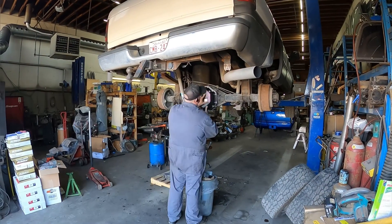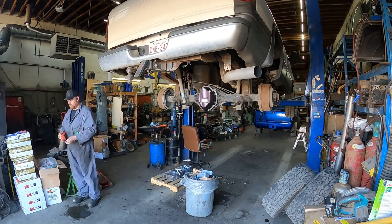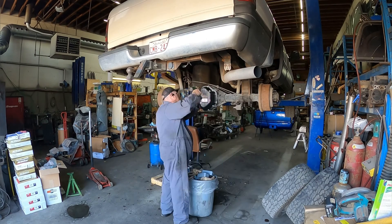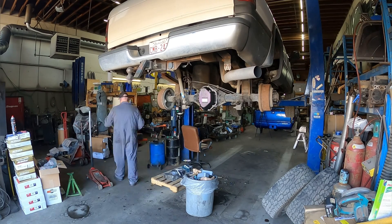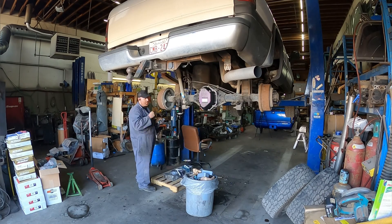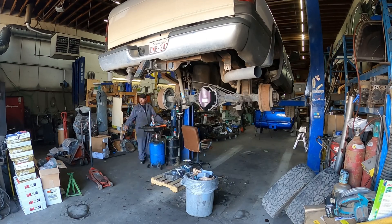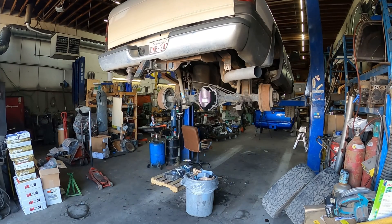I guess I didn't film a proper outro for this — just got the bolts put back in the axles and all that stuff sealed up. Everything's good to go. Ended up with about 9 thou backlash. It's not an exact science — moving the carrier over 5 thou doesn't always give you exactly 5 thou depending on your preload. Nine thou is what I ended up with and I'm happy with it. The diff does shift going in and out of gear much nicer than it used to, so that was the object of the game. Like, subscribe, hit me in the comments, and remember: it's not rocket science — if you're going to be dumb you better be tough.